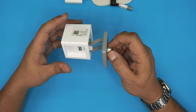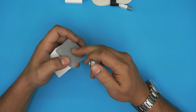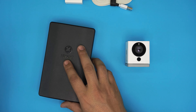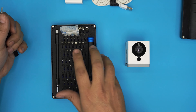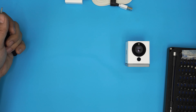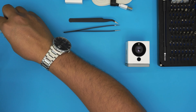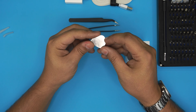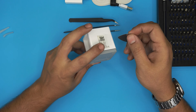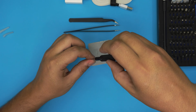It won't hold its weight fully — it slides down a little bit. It is kind of powerful, so I wonder what kind of magnet it is. Let's open it up. Before we open it up, we're gonna need a few tools. I'm going to use an iFixit screwdriver set — they have one of the best bits out there. You're going to use a Phillips number one and Phillips double zero. We'll also need curved tweezers, flat tweezers, and for opening the case I'm going to use a metallic guitar pick, which is suitable for opening electronics. First, peel off the bottom sticker — just rip it apart.